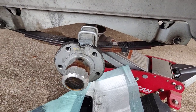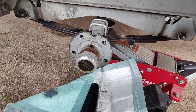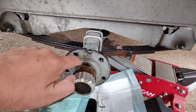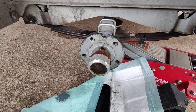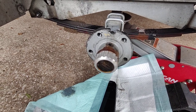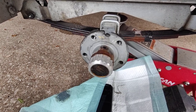I'm thinking about spraying some silicone on there, although I don't think it'd be a lasting solution anyway. What I wanted to summarize is on these hubs — these are 1/8 NPT threads, at least on mine. I bought a five-set of stainless set screws, or fill plugs, on Amazon. 1/8 NPT.